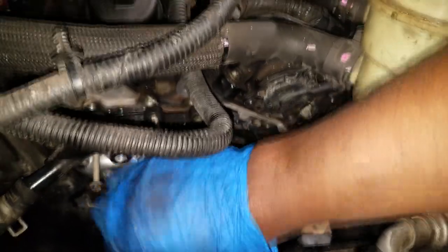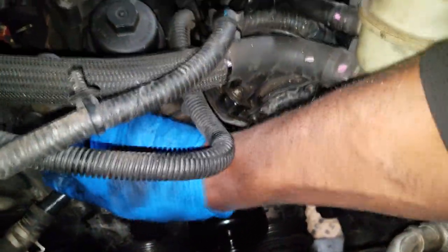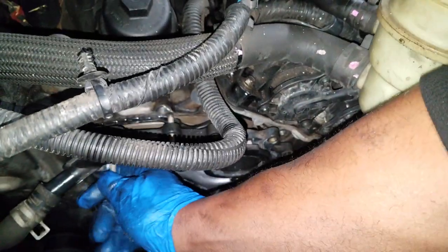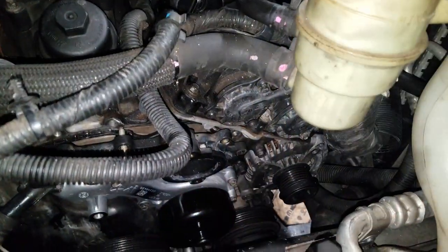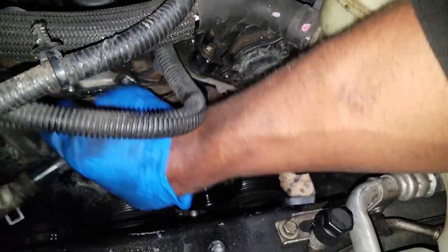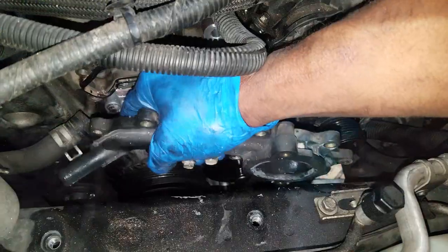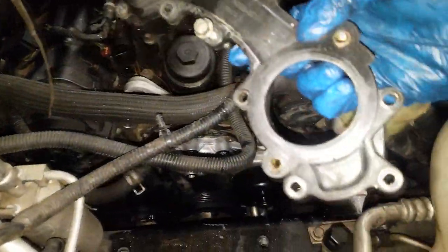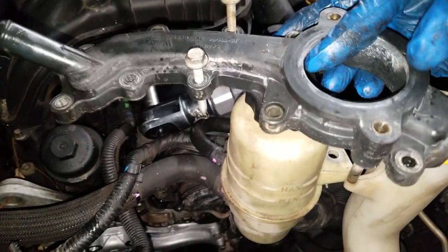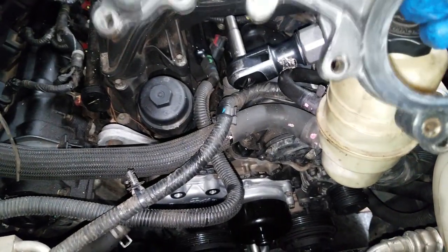This should be ready to come off by now. Yes, this will trick you — you would think it's your water pump. Now, depending on the mileage, it's probably a good time to go ahead and replace the water pump while you're down there. Get a thermostat, water pump, and a crossover tube. A crossover tube is not really a wear item — it doesn't just wear. Here it is, ladies and gentlemen, your crossover tube. It may be hard to visibly see the crack, but this thing was leaking right up in this area. This is the part that was replaced — there's a stress crack on here.